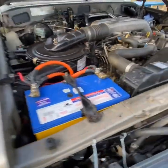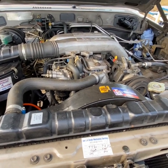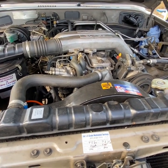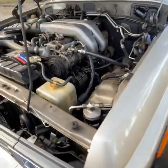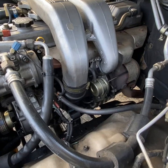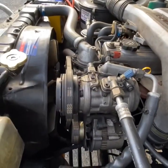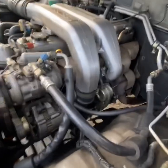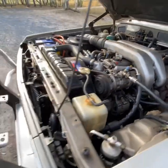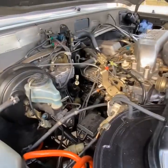Here's the 12HT — arguably one of the best engines Toyota ever produced. It's a factory turbo diesel, oil-cooled turbo. There was a bit of an oil leak which I've managed to fix, though there's probably some blow-by. The turbo and entire engine need a good going over. I've replaced all the belts and serviced it — I do it every 5,000 k's. It does use a bit of oil and has an oil leak on both sides of the engine, which is frustrating, but we'll get there.